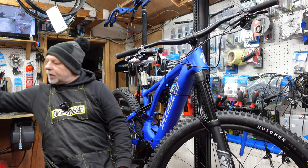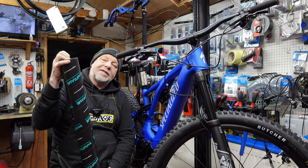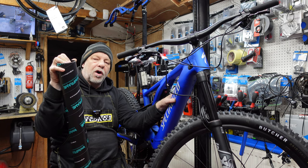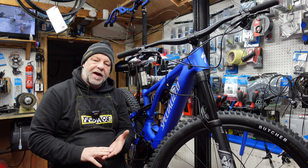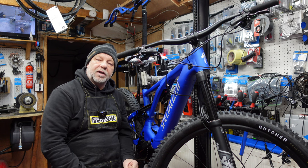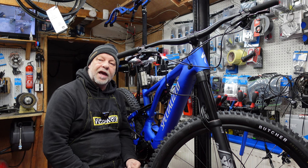So the kit that we need, we've bought already. Like I said, it's here. I need to mention that the temperature where you're going to actually put this Invisiframe on your bike needs to be over 18 degrees, 18 and a half degrees, just purely and simply because the kit adheres better at that temperature. It's also important that you've got your squeegee bottle, or your spray bottle, with the right amount of water in there. And we use Johnson's baby shampoo. I think there's about 800 mils of warm water to 5 mils of Johnson's baby shampoo. You can use a little bit more, but the ratios are in the instructions that you get with your Invisiframe kit.